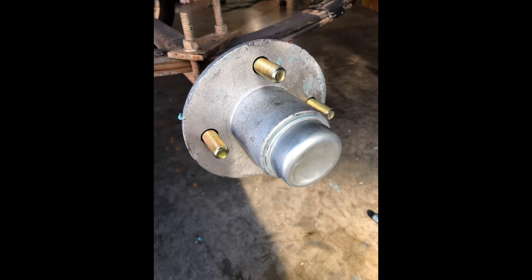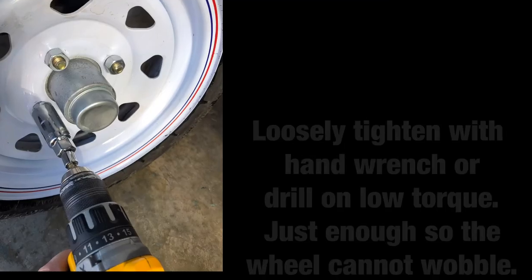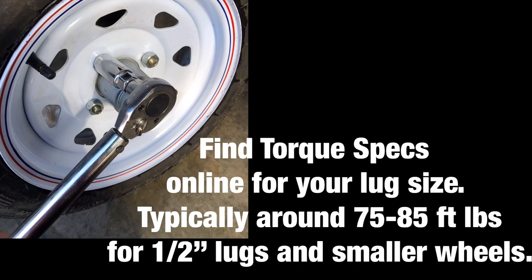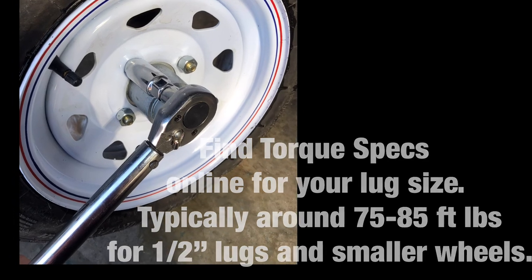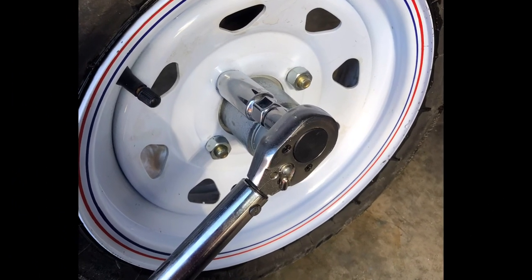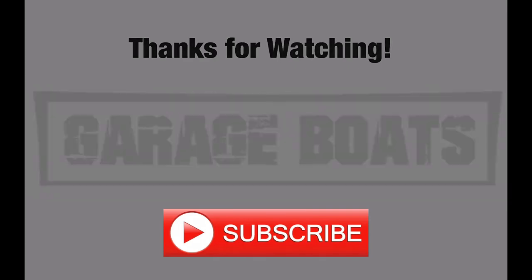Once the cap is on, go ahead and stick your wheel back on. I use a drill on low torque to lightly put it on, then torque them up with a torque wrench — starting around 50, then going to 75 or 85. But you should torque to whatever the manufacturer spec says for your own wheels. Thanks for watching — subscribe to the channel for more content coming soon.